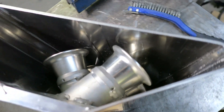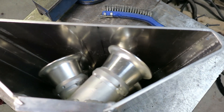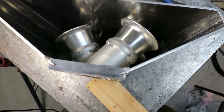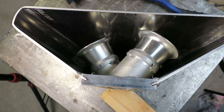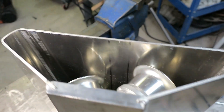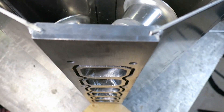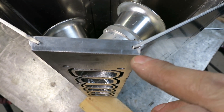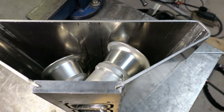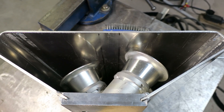The challenge with the design is that I'm limited by clearance to the top of the bed on the back, so the top is a little lower than I would have liked. But the overall volume is about 300 cubic inches, which is one and a half times the displacement of the engine — that's what's recommended. I've got it all welded solid to the base plate. I talked about these rabbits I cut in the base plate — so it's not just the weld holding it. The welds tend to be the weak spot on some of these plenums, which is why I elected to bend the main body up out of one piece.